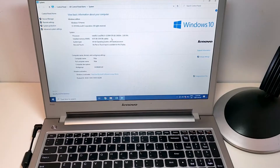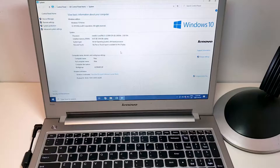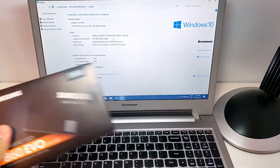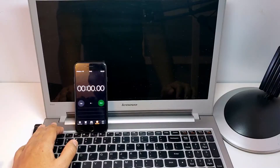This is actually my sister's laptop — she's been using it for school but complaining a lot that it's getting slow. The specs on this laptop are not that great either: it has 6 gigabytes of RAM, an i5 third-generation processor with a clock speed of 2.6 gigahertz. The specs are not great, but we might benefit this laptop by replacing the drive with an SSD.